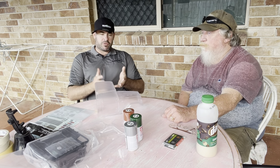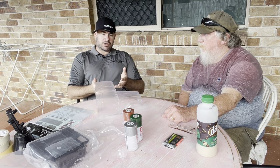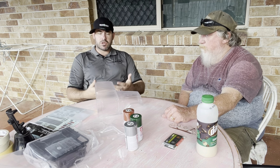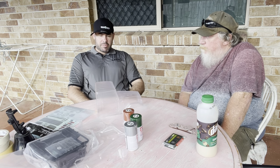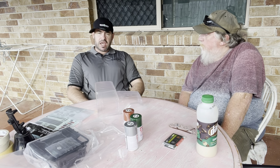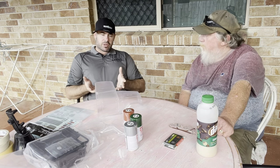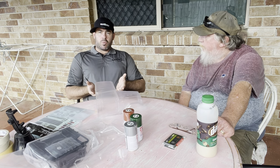So once you've really cleaned it out, then you've got to use washing detergent to degrease it. But then you've also lost all your stickers and your window masks, so it's a massive process to redo it. So you kind of don't want to rush. Now for people who've seen those cars at shopping centers where the clear coat's peeling, like sun cancer, from being exposed to the elements and the hail damage. If you have a look at cars with big panels, your rust is going to form where the weather pools.